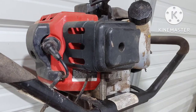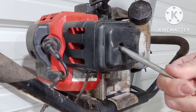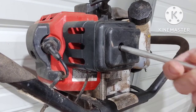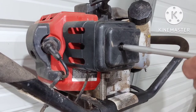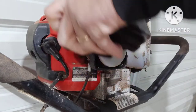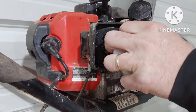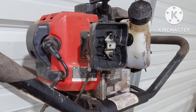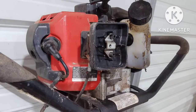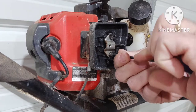Alright, so I'm going to start off with taking the cover off here. This is just a Phillips head and the air filter is underneath it held on by the same screw. It's got a small cover and a little filter element. Alright, then we have two Allens here — these are holding the carburetor on as well.